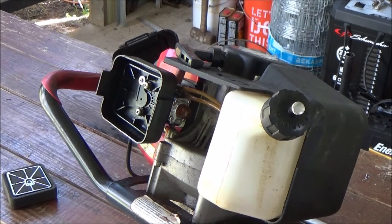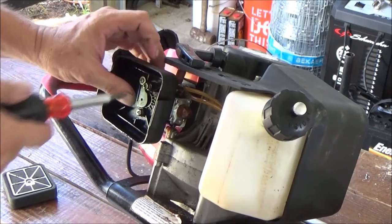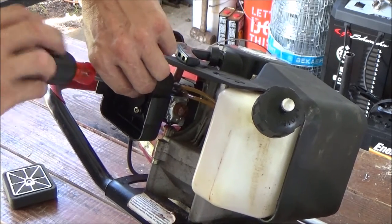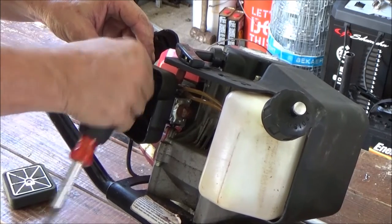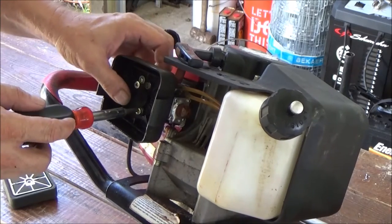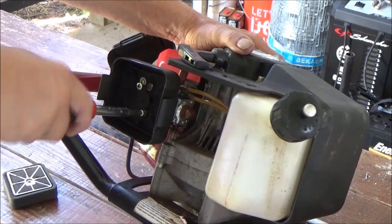I got this particular machine at a yard sale, believe it or not, and I did not pay that much for it at all. The guy who originally had it bought it to put some fences in, used pre-mix in it — this is a two-stroke — and then let it sit. You know, the typical problems you have with a two-stroke when you do that. Now here on the Toadstead we do use the pre-mix synthetic fuel. It's not cheap at all, but it seems to be working really well with not leaving as much residue in the fuel system on these two-stroke machines, whether it be this one, the chainsaws, or the weed eater.